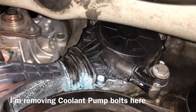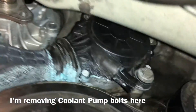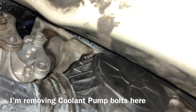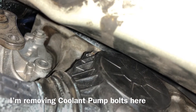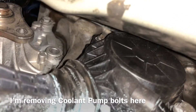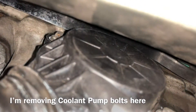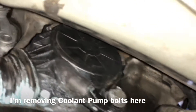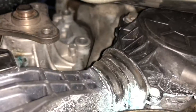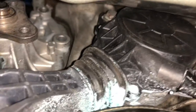This part is a little tough. I'm probably going on about 40 minutes and I managed to remove that bolt, that one over there, and the one hiding behind there. That one I was able to loosen but it's just so far away that I can't reach it with my hands to take it out, and going half a millimeter at a time with a wrench is just taking forever. I still think it's doable without removing this thing, because to remove it you also have to remove bolts that are way in the back and you can't get anything in there unless you have specialized tools from BMW. After probably another 20 to 30 minutes I finally got that last bolt out, so now I can just pull out the water pump. Hopefully it'll come out easy — I'm sure it won't, everything's been kind of hard on this one.